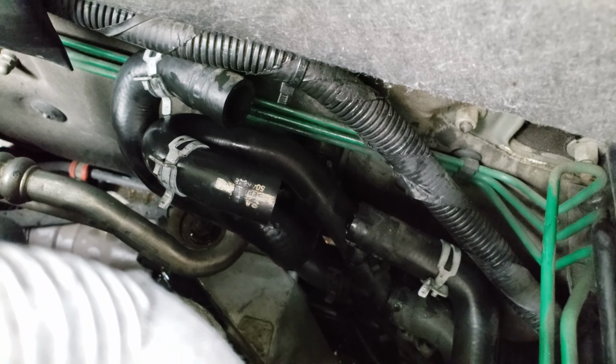Well, it's all back together. So I ended up having to tee off. I broke another thing there. That fitting right there. That thing there with the vacuum line coming out has two vacuum lines, and its sole purpose is to be a tee. So since I broke one of the nipples off, I epoxied it closed and stuck an old school tee on the vacuum lines and called it good.